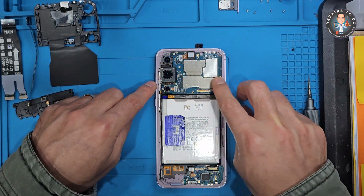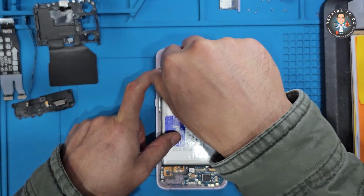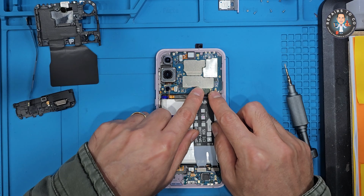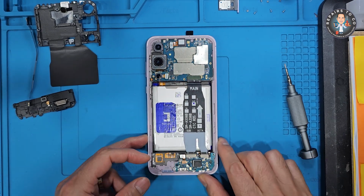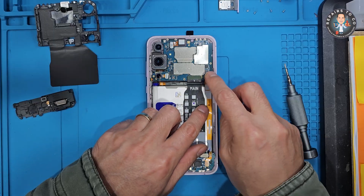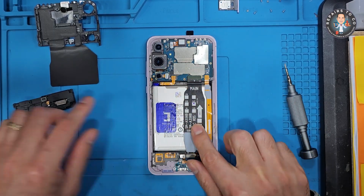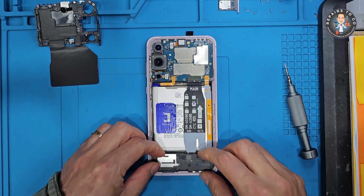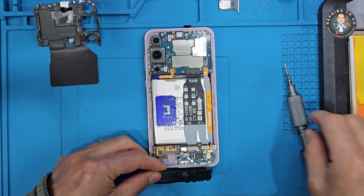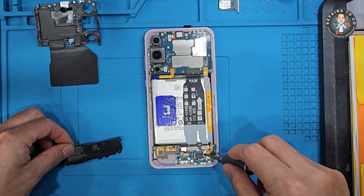Compatibility risks. Low-quality aftermarket full assemblies, if not genuine Samsung parts, may result in issues such as poor touch sensitivity, lower brightness, or display lag. Void warranty. Performing a third-party screen replacement may void the device's warranty, especially if unauthorized service centers are used. Risk of improper adhesion or water resistance loss. After removing the back cover and frame, water resistance is compromised. Without proper sealing and adhesive, the device becomes vulnerable to moisture and dust.